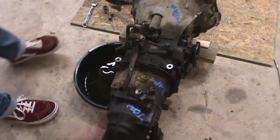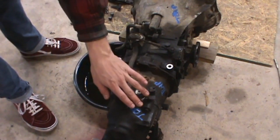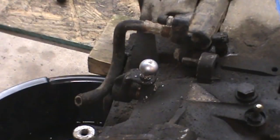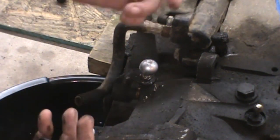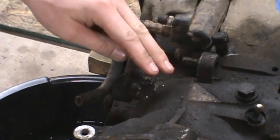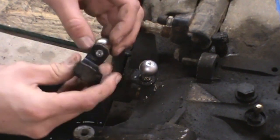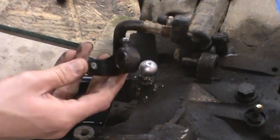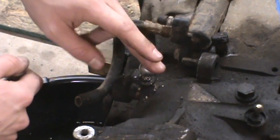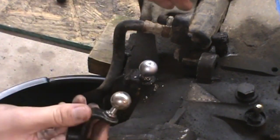If you got your 200 transmission out of the car, you've likely already disconnected the linkage — the junkyard just stripped and cut it off to get it loose, so I have to remove it here but yours should already be off. One thing to notice: if your shifting feels really loose, you can see on this one the ball is really well seated, but on my old 4000 transmission the ball has a lot of play in it. I've heard of some people just welding the bottom of the ball back in if you only have one — that's what I recommend. I'm keeping the one off this 200 because it's tighter and it's actually going to crisp up the feel of the shifter.